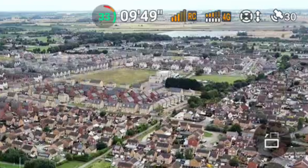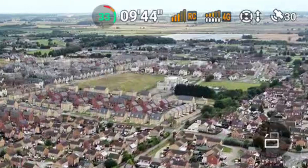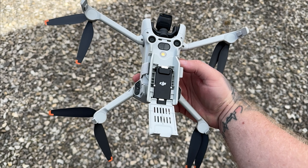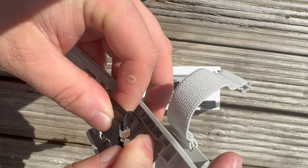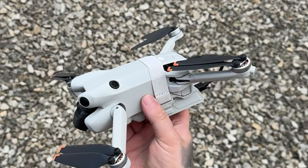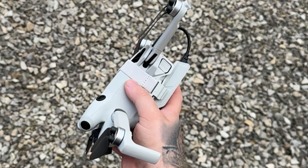It's worth noting that you are not using 4G all of the time when this is plugged in — this is basically to keep you with a strong connection when you are not using OcuSync. While you are using OcuSync you are not consuming data from the 4G dongle. To fit it to the DJI mounting kit, just slide it in with the DJI logo facing upwards, mount the left and right antennas, strap it around the drone with the hook, plug in the USB, and you are good to go.